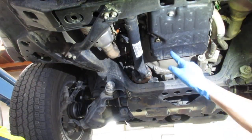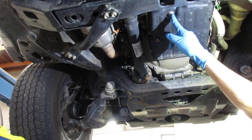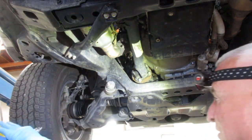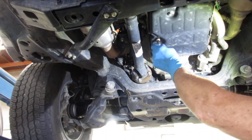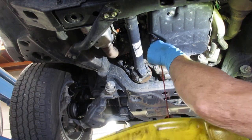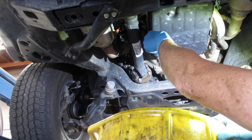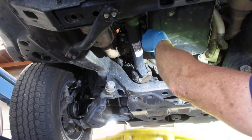I just started to take the plug loose a little bit. This is the one where you check the fluid level, and this is the one where you drain it, and then up on the side there's one where you fill it up. The fluid's supposed to be a bright red color. We'll pull this off here — you can see fluid's running out, so it's got plenty of fluid in it.